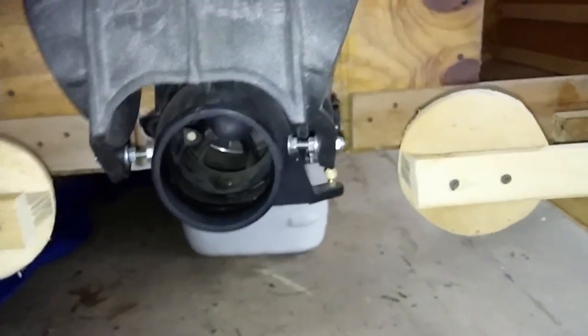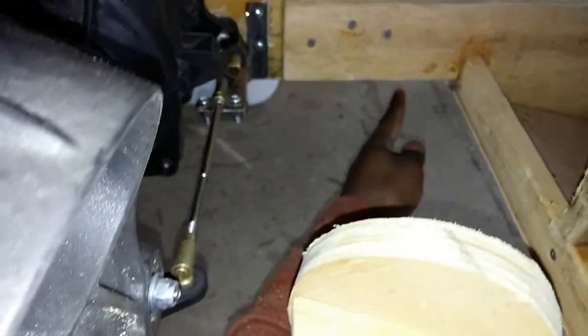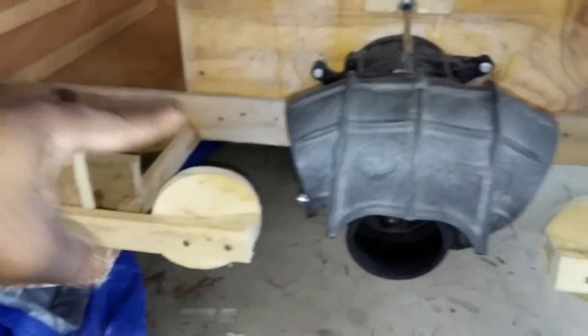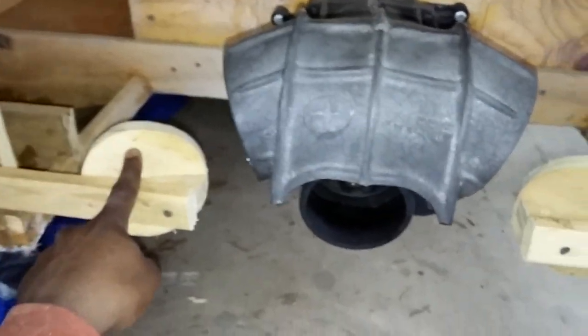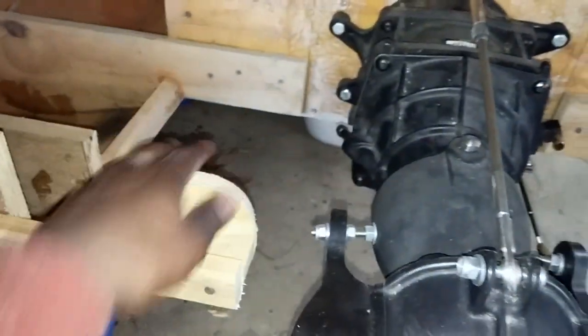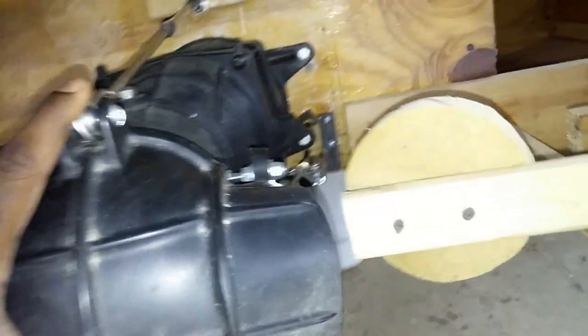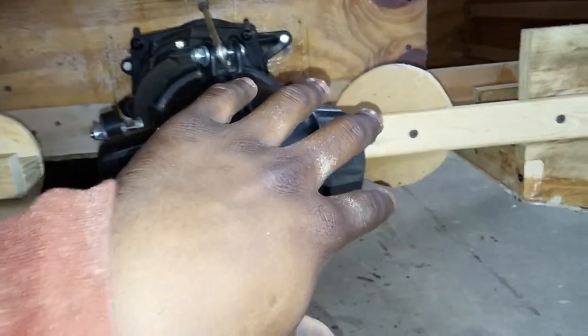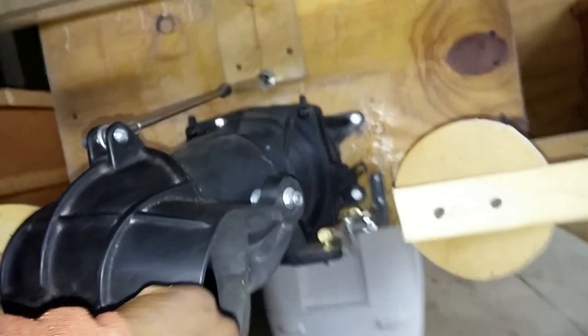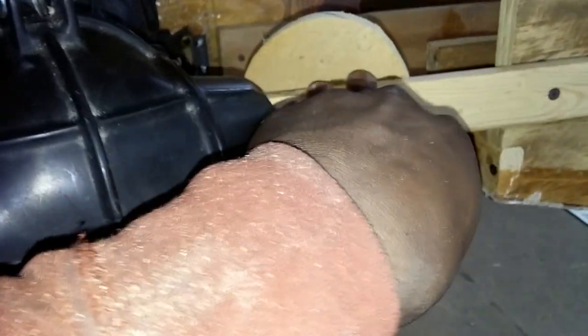How I plan on this working is to take the fleece, basically fill up this whole rectangle gap at the bottom of the boat, pick up the fleece from the bottom, stretch and pull it up over the top of these two curved pieces right here. The fleece will be shaped like a comb going to this point, this point, and that focal point over there. In theory, when the reverse bucket is dropped and I turn, it's going to shoot water out this nozzle right here, going under the fleece and back that way.